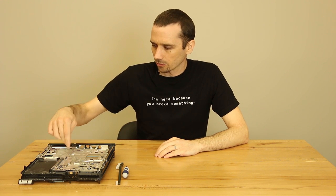I want to talk about what actual overheating looks like on a PS4. A lot of people think that if their fan is really loud and it feels hot to the touch, then it's overheating — but that is actually not true. What happens when a PS4 overheats is you'll get three loud beeps, and then the LED in the middle of the PS4, which is normally white, will turn red and the PS4 will shut itself down. That's actual overheating. If it's actually overheating, it's going to turn itself off and let you know something's wrong.